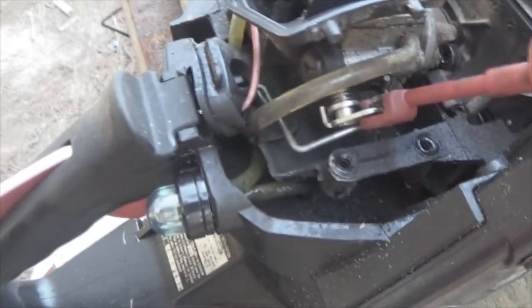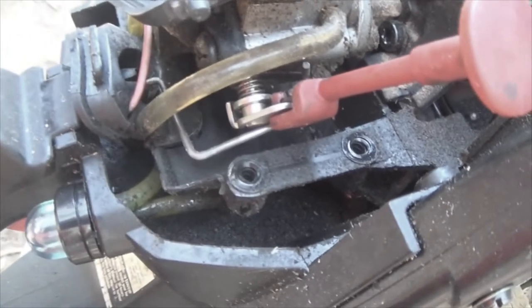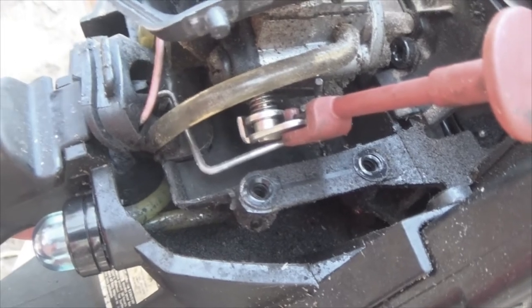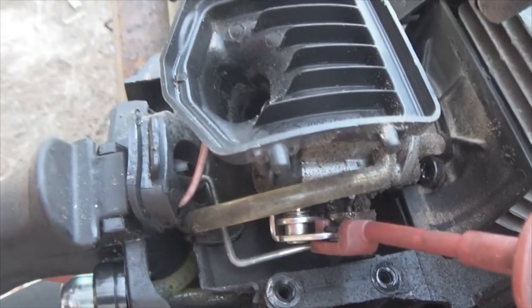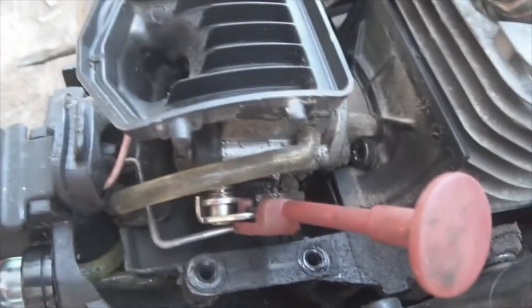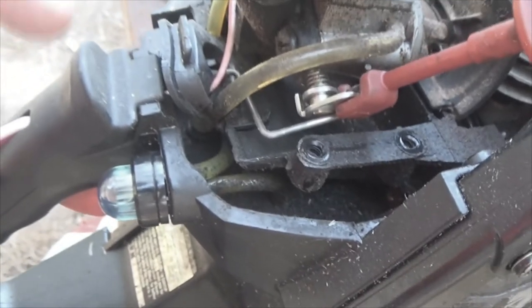I needed a pair of needle-nose pliers to hold down on the long line because when I disconnected it, it was spraying out. I don't know if it's because of tank pressure inside trying to flow out or what — I have no clue. But I have got it primed. As soon as I clean the air filter and reassemble it, I'll run it for a moment to make sure there are no leaks. If there are, I'll break it down further and replace the fuel lines.